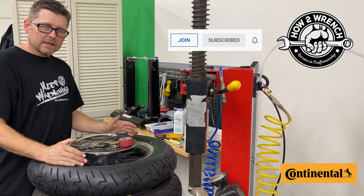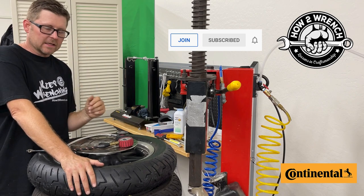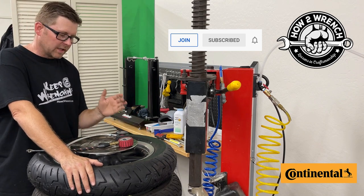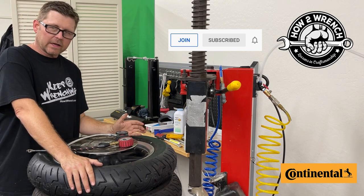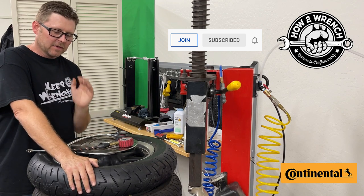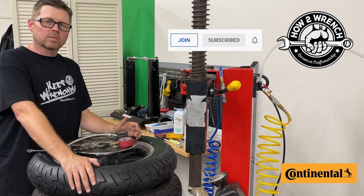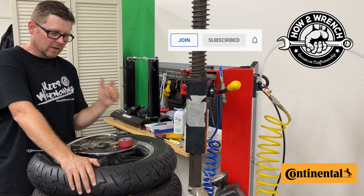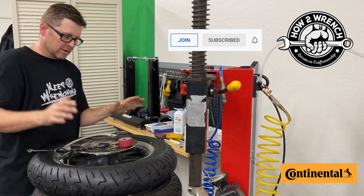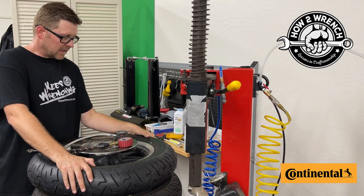In the riding season, don't just check the pressure at the beginning of the season and think you're done. It's a good idea to check tire pressure as a regular checklist item before you ride. Especially if you're hopping out on a long-distance tour, check those pressures and consider setting them according to the weight, number of riders, and so on, as found in your owner's manual. That's how you make them last longest and perform as designed.